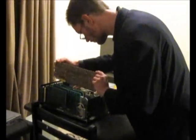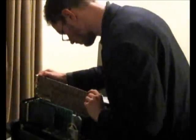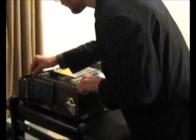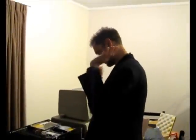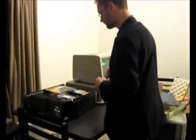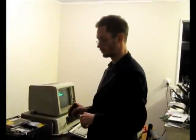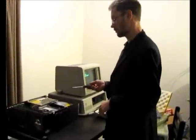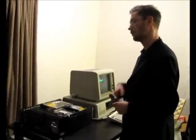I've been trying to use the original screws in this machine. The XT didn't come loaded with those little slot adapters — there's only one in this machine, and we're going to use it right now. This card has never been powered up, so if it goes pop, we're hoping it works alright. The important thing when you go from monochrome to colour on these XT machines: you have a set of switches on the motherboard. At the moment they're both off, which is the setting for monochrome. We're going to click switch number 5 on to change it into colour mode, so the computer won't look for the wrong device on startup.